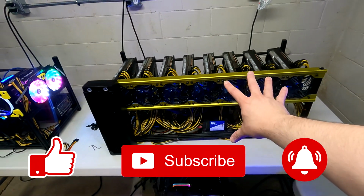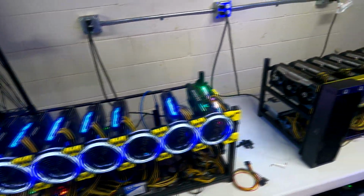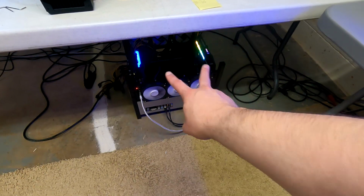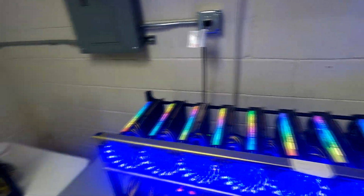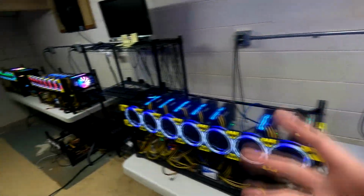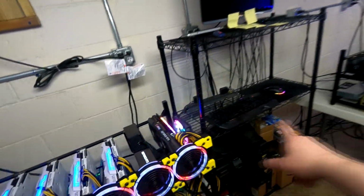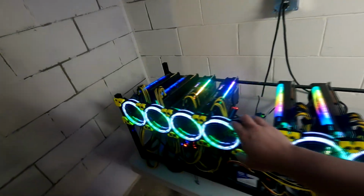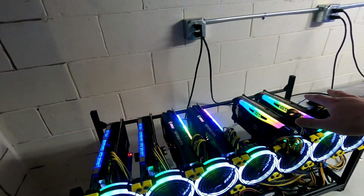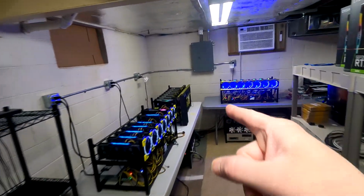Not only do I have that to work on, which I'm not going to be working on right away, I still have thermal pads to take care of. Now, the cool thing is, thermal pads in this whole guy have been replaced. The 2 down here have been replaced. Those are both 3090s, and for whatever reason they run hot. All the thermal pads in this guy have been replaced. None in the 3090 because they will be replaced when I do the water cooling, so it's not like doing that again. All of them here have been replaced except for the MSI guys. I haven't touched the MSI guys. This one I still have to work on. So once I get all the thermal pads on the normal cards taken care of, then we hit the water cooling setup.